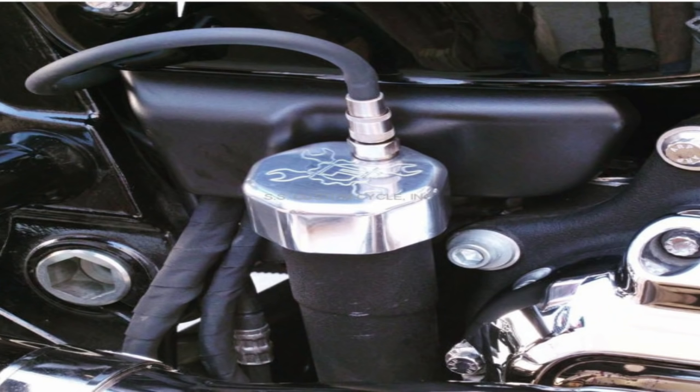It takes a little bit of time for the engine oil to actually build up, but the more you ride the bike, and the hotter the oil gets, and the longer you're riding it, the more likely this issue is to actually present itself to you. Now improving crankcase ventilation will help even with the older style oil pump, but in the end, the only true fix for the problem is to go ahead and upgrade the oil pump.